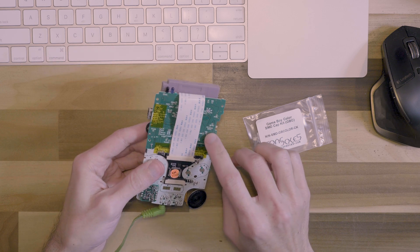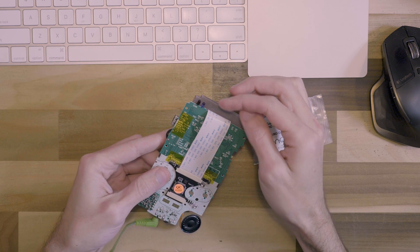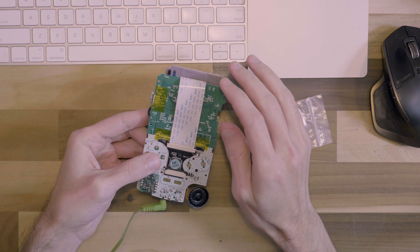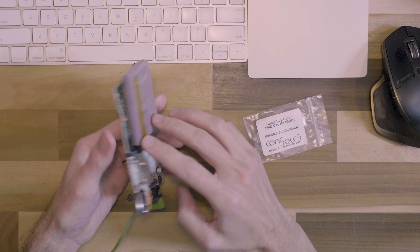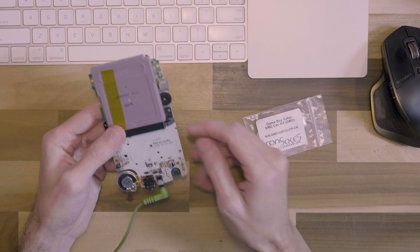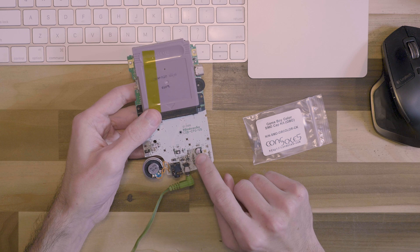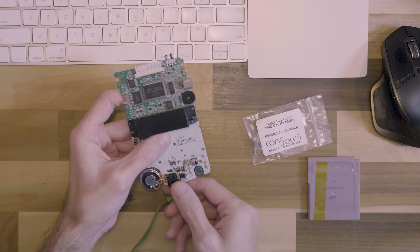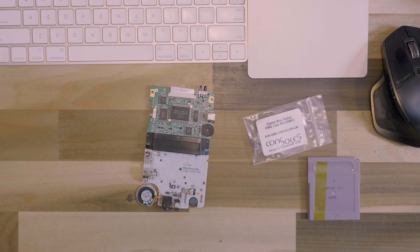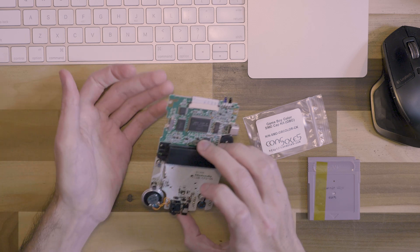The system is functioning, and when you plug in an OEM screen it works. So it's not an issue with the overall system — I think it's definitely an issue with the capacitors. But real quick, let's go ahead and try cleaning the Game Boy thoroughly first.